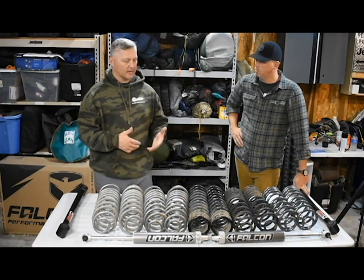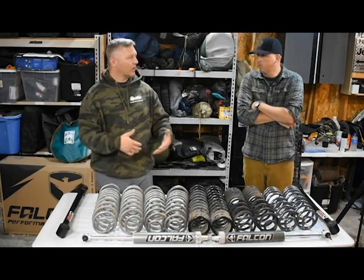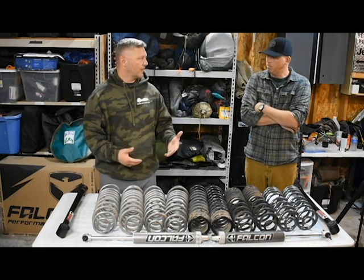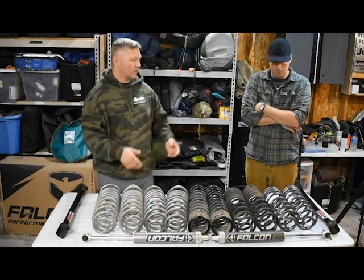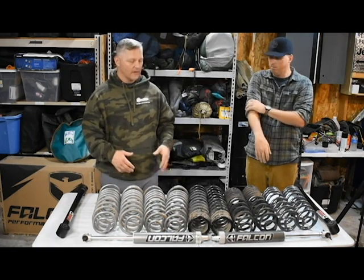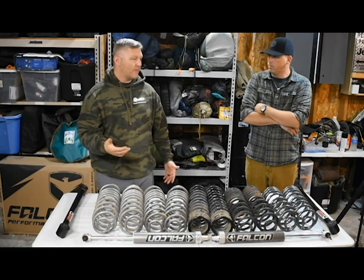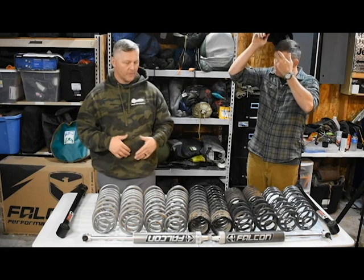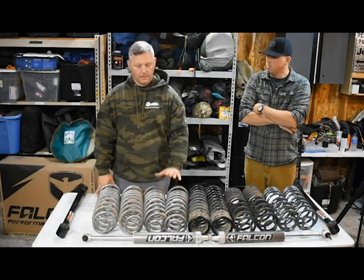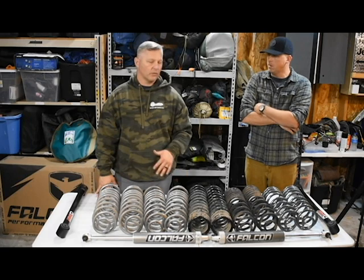As Brian was saying, this is not anything to say 'this is exactly what you need to buy.' Do the research. We're coming from a rock crawling background where soft suspension and lots of suspension travel is ideal — body roll isn't really a thing when you're topless with no doors. But with the overlanding concept, a lot of our weight is way up high — 180 pounds in the tent above the hard top, not including the water, the annex, and everything else. It's crucial that you pick the right suspension setup for your journeys and your rigs.